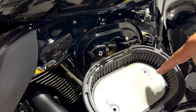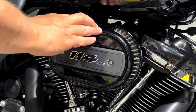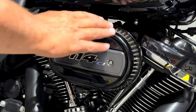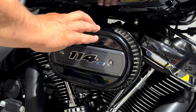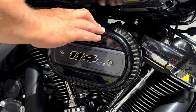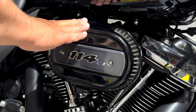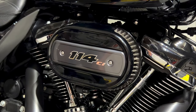As you can see, there is still a little bit of blow-by. Venting the crankcase only is not sufficient to completely eliminate the blow-by from these M8 engines. I checked my hose and it was venting properly — you can put a lot of pressure there and it will go out — but it looks like there is still some blow-by from the heads. So the next step will be to vent the hoses from the heads coming into the throttle body and vent those externally. I'll definitely keep you guys posted, and if you have any ideas or comments, please let me know. It looks like venting the crankcase by itself was not enough.